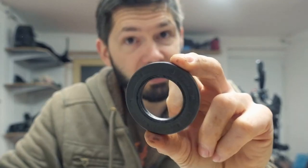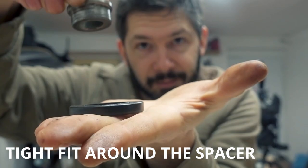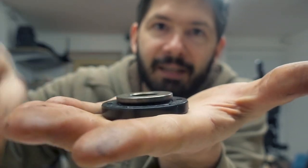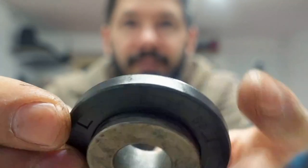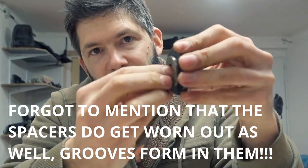How can we tell when seals are getting worn out? If I take them like this and put them in, I shouldn't be able to just lift this up — it should be clinging on to the seal. This one is a new one, and even getting it in is tough. That is how tight it should be: no play, you cannot move anything. Checking the seals is super easy — you take the wheel off, wiggle the spacer, and if there's play, then the seal is done.